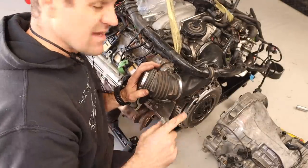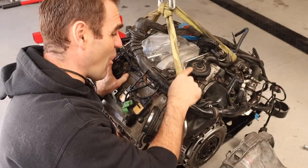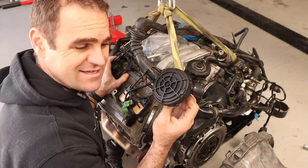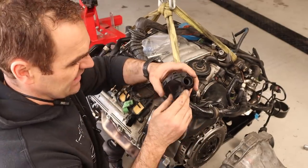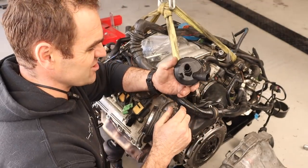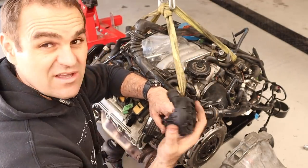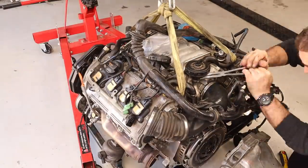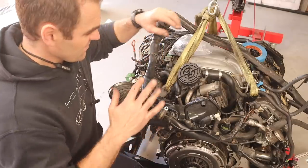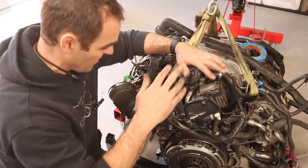The next thing I want to tackle is the PCV — when I bought this car, it honked like a goose, and that was the result of the PCV. I did buy a replacement, but it seems like it's actually not the correct part. It's a similar PCV but not the same one, though it looks reasonably close in size, so I'm going to see if I can make it work. It just has to stop the thing honking. It's not the right part and I couldn't send it back, so it's just easier to use it — and that works fine, it's all connected up now.